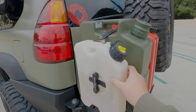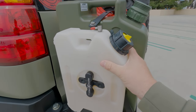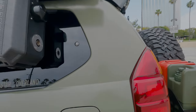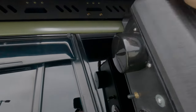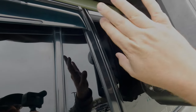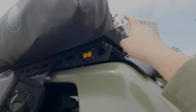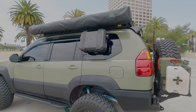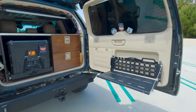On the left side I have the Rotopack mount with the Rotopack water carrier, but I filled it with diesel fuel. I put a little fuel outlet that runs over to my diesel heater, which is mounted on the side of the vehicle. The fuel line runs on top and comes right in, the cool air goes into the diesel heater, it heats up, hot air comes out, and I pipe it right up into the RTT. Super simple — got the diesel heater and case on Amazon.